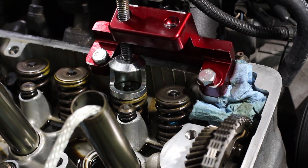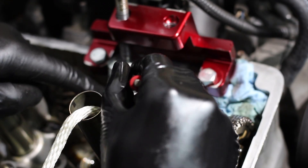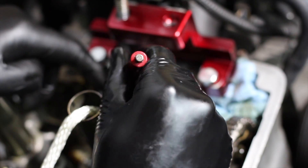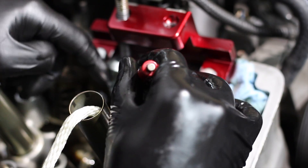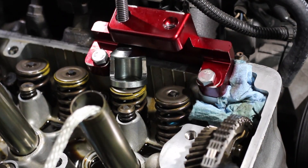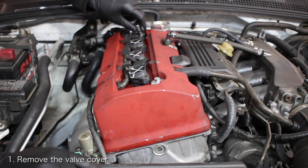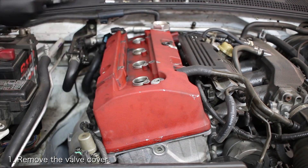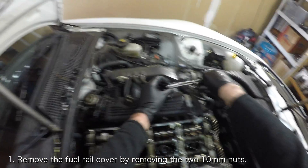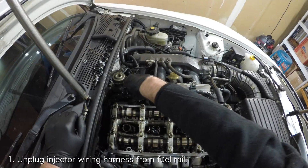This job can be quite intimidating to tackle, so if you haven't already, I highly suggest you watch my video on inspecting valve retainers and performing a valve adjustment, as it will be very relevant. Before you start this procedure, you want to ensure the motor is cold. Depending on how tall you are, you might want to jack up the front of the car as it will make the job a lot easier on your back. Once you're ready to tackle the job, remove the valve cover — I've got videos linked down below if you need help. Once the valve cover is off, you need a little extra room to work with, so remove the fuel rail cover and then unclip the injector wiring harness from the fuel rail.